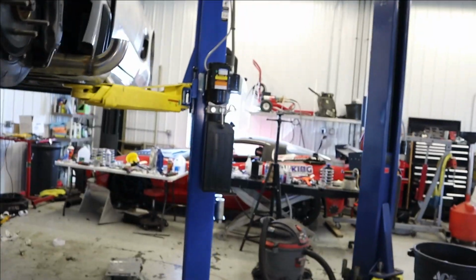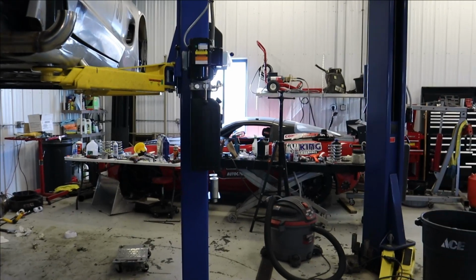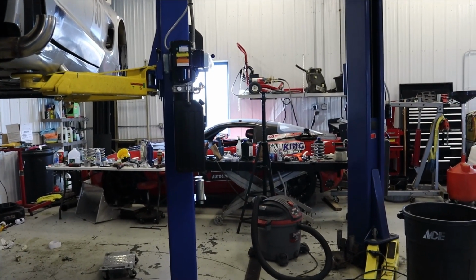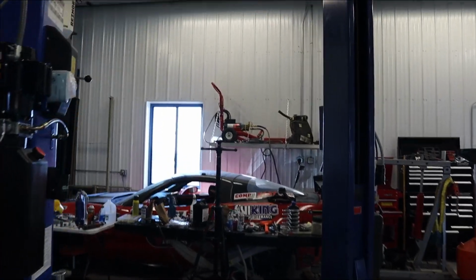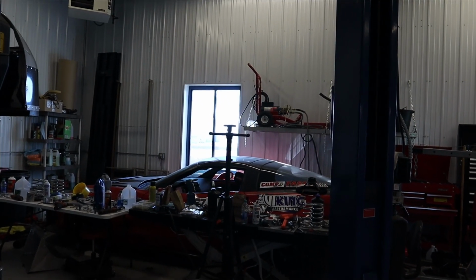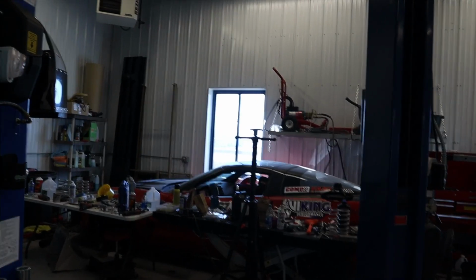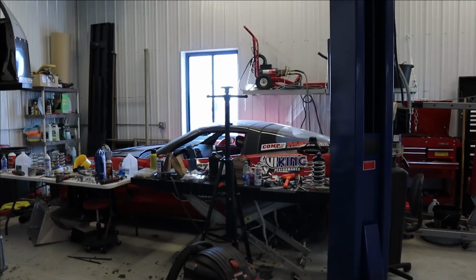So with the red car at Mid-Ohio, we were having an issue getting through a bump because it really upset the car and you'd have to lift tremendously, and that was right before the acceleration zone towards a straight. So you couldn't carry as much speed, and then it's compounding the whole straight. So we took some high-speed compression out, and we got through that bump so much better, and we were able to stay on gas through the bump.